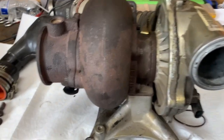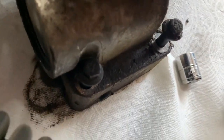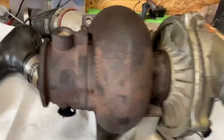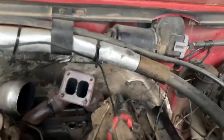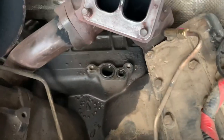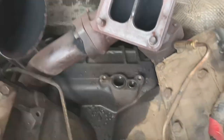Here's the turbo out. You just have to get those two back bolts out enough — it's pretty hard to get to them, but there's the turbo. Make sure to always use new O-rings; don't try to reuse them. Pick the old ones out, get some high quality ones, and put them in.